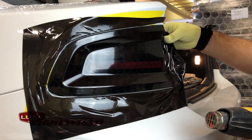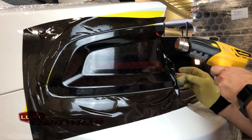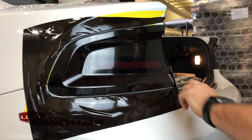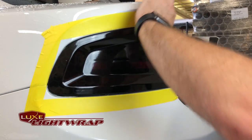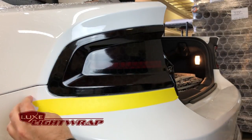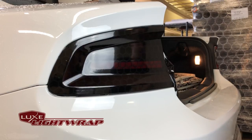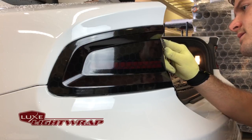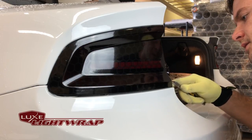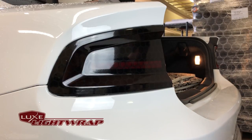Now that it's back behind the lens, I got a little wrinkle — while it's warm I just heat that out and apply it back down. Make sure we get it nice and hot and pull this off the car. I used yellow painter's tape because I could tell the car's been repainted and the vinyl does grab somewhat aggressively. I don't want the body shop to not have prepped between the paint layers correctly and us pull up some paint — that would be very hard to explain. Come back right behind where the plastic is and trim. This is going to look almost OEM — one side of the lights done. You can see the honeycomb effect there; looks great.